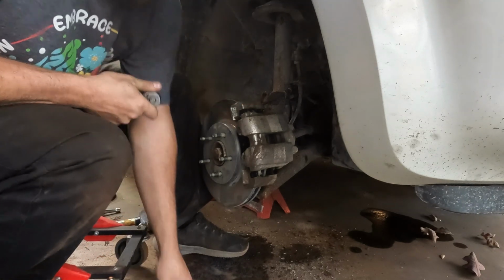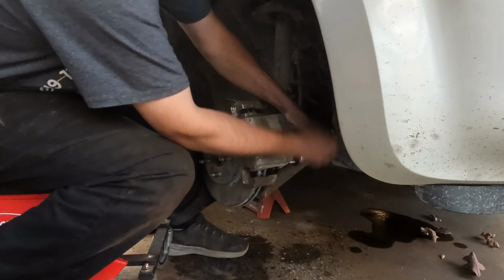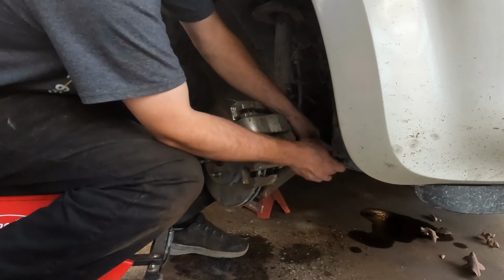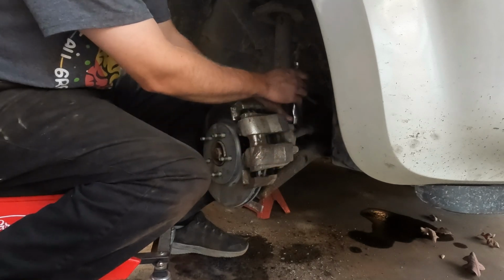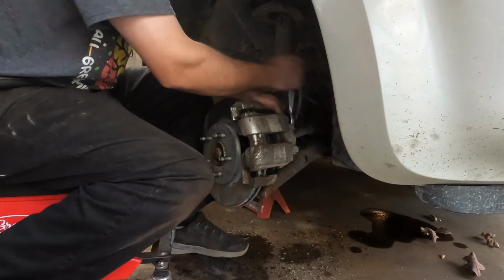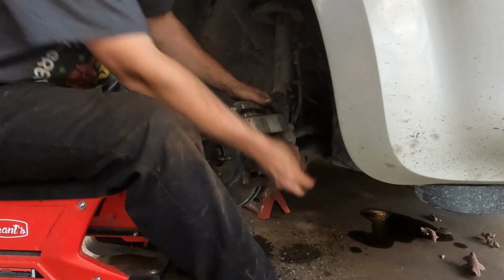Remember, those are that weird 9mm. Also, there should be a little bit of grease on those slide pins. I didn't say that. These ones had some on it, so since I didn't go through the process of putting grease on them, I guess I didn't say it, but it doesn't take a lot, just a little bit. Make sure they don't seize in place mostly. And get them tightened up. And little plastic caps kind of cover them up.